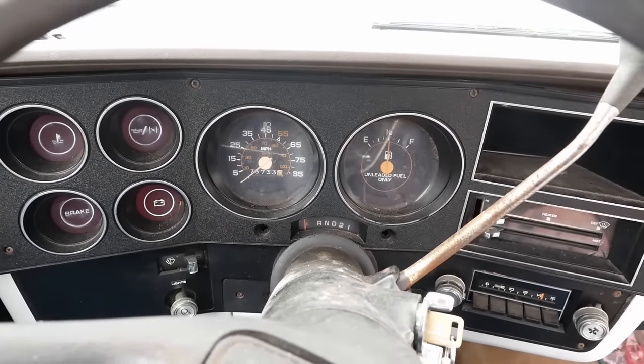on these levers. Now the levers aren't going to move because, again, they have tension from the throttle. But every time that you tap the throttle, these levers can come down as far as the bimetallic spring will allow. Should take a couple minutes for the bimetallic spring to fully open up. And at that point, tap the throttle, and now your choke is fully off, and your fast idle is fully off. So now you're back down to your base idle. That's the way it's supposed to work.